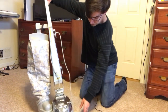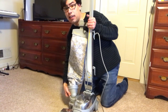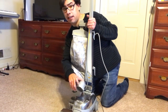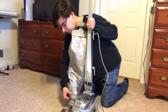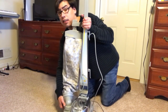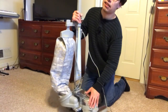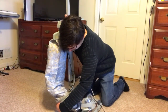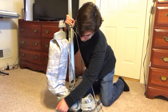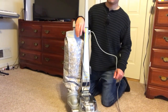What you need to do is make sure that when you put the bag on, there are two arrows — one on the exhaust port and one on the boot or mini emptor. You're going to line up those arrows, push it straight down gently, and then push the emptor toward the machine — you've got to push it firm so it'll lock in place. Now the Kirby will turn on.